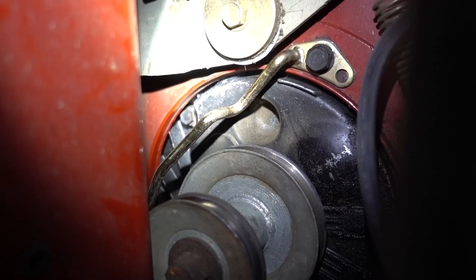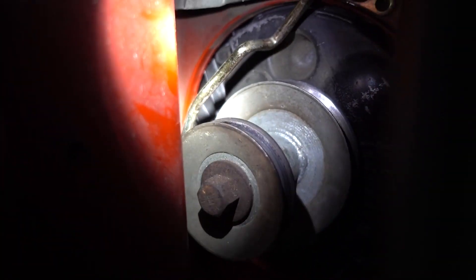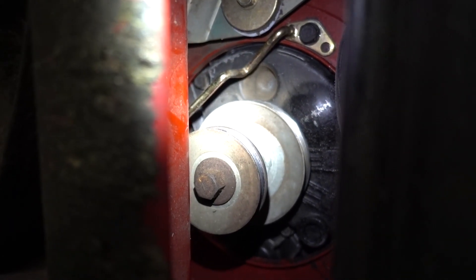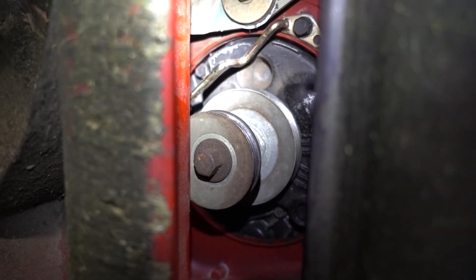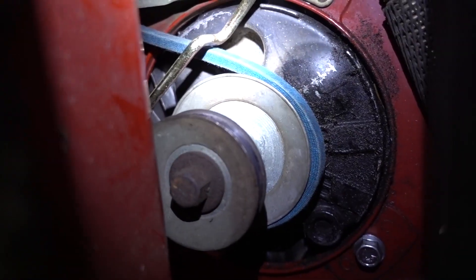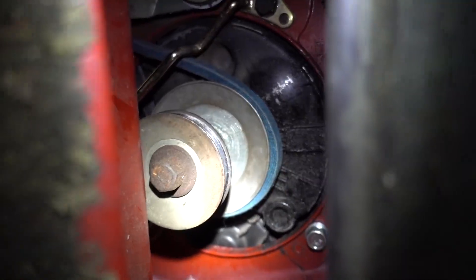There's a little gold bracket in here that I was trying to avoid taking off, because it's not easy to get a wrench down in there. With the old belt it slid right in between the pulley and that bracket, but with the new one I'm going to have to take it off because it's a little more stiff. You may or may not have to take that off, but I'm going to — put the belt on, and then put that bracket back on. All I needed to do was pinch it in between the gold bracket and the pulley, then pull some slack through and pull it around the lower pulley and slide it on.